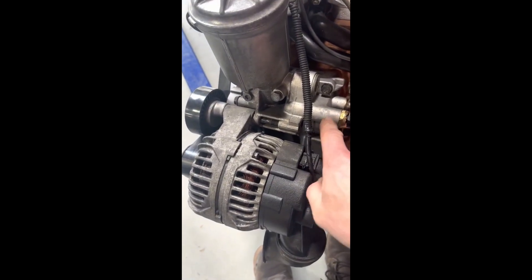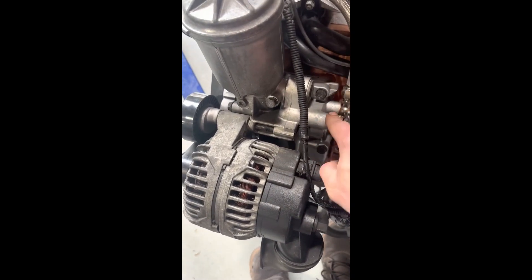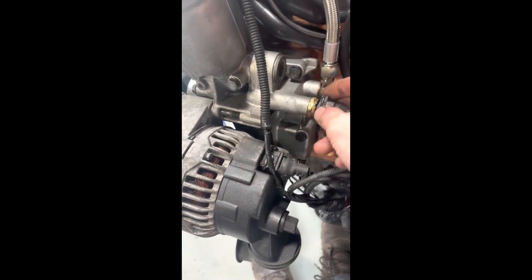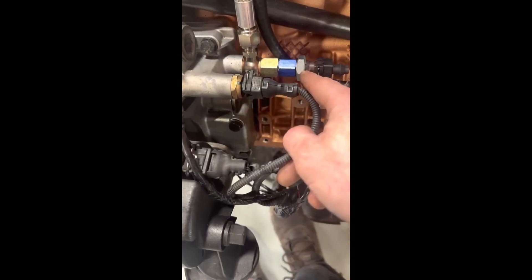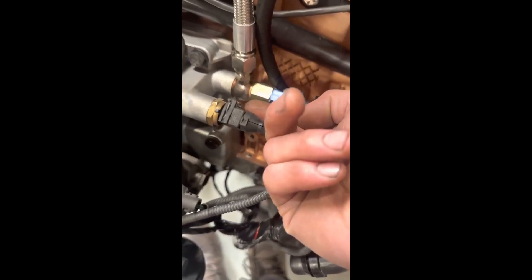The M54 housing has an oil temp sensor and oil pressure switch, whereas the M50 housing only has one port for the pressure switch. So what I did was relocate the temperature sensor to where the pressure switch would normally go, then used a banjo adapter adapted to an 1/8-inch MPT and then back to M12. The reason I'm doing that instead of going straight to M12 is because eventually I'm going to put a T in there for an aftermarket oil pressure sensor and gauge.